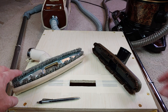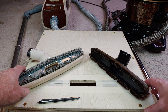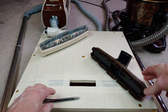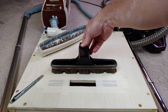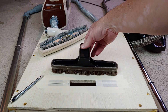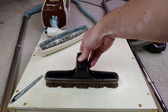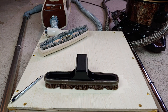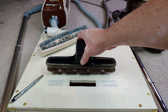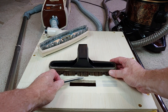Since these things are symmetrical, all I really need to do is just measure one side. So what I'm going to do is start my anemometer, and then take, say, this Rainbow floor brush for example, and run it over this opening. I'll kind of keep it constant right there, maybe wiggle it around a little bit to try to get the best measurement possible. And we will see, from the center location in general, what kind of flow we get.